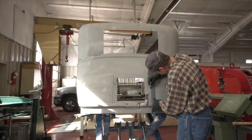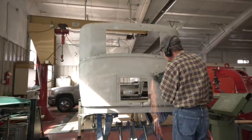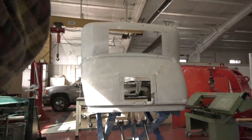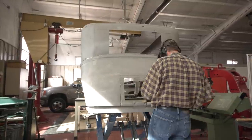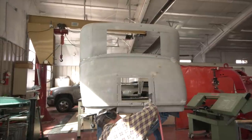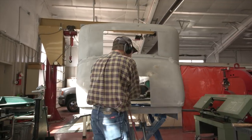Time to lay out some square lines and make our final cut for our panel. We'll get out here into some nice virgin metal that hadn't been welded on or messed with. So I came in here with my pneumatic tool with the saw on the end of it. We could use a plasma cutter too, but it just puts too much heat in it and I need to keep it as cool as possible to keep the warpage down. This tool worked out beautifully — cut it out, clean it up a little bit, then off to make the panel.